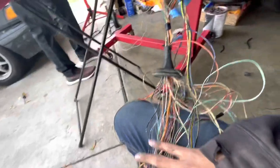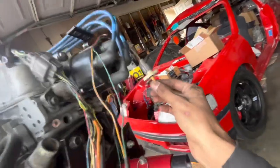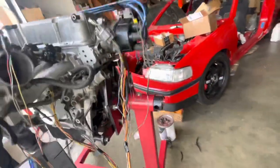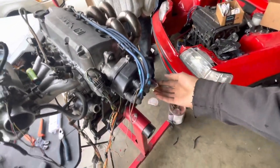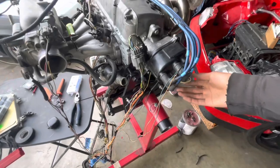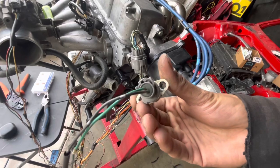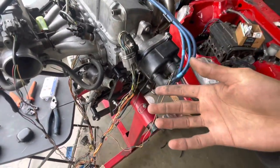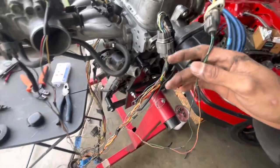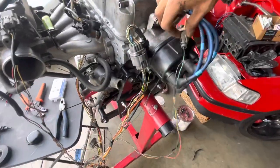Another thing: I did my IAT sensor. OBD2 harnesses don't use the IAT sensor on the intake manifold like we're used to, and the push-in style would pop out under boost. Speed Factory Racing makes a little two-bolt aluminum flange you can weld to your charge piping — we're going to order that, get it welded on, and then bolt the IAT sensor to it, probably tucked somewhere out of the way.